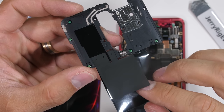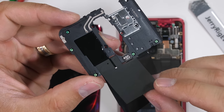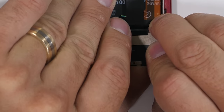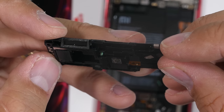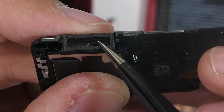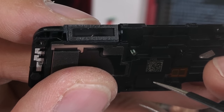The K20 Pro has a square NFC pad on the back. It's a smaller signal coil and not the larger power sharing wireless charging coil, but the technologies are still pretty similar. The bottom plastics include the loudspeaker, and check this out — the speaker has the same water resistant mesh we've seen on Ingress protected phones. I'm beginning to think that Redmi added the water protection but didn't pay for the certification, kind of like OnePlus did a while back.